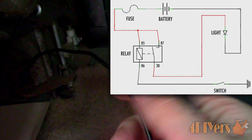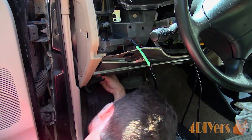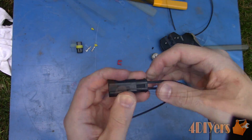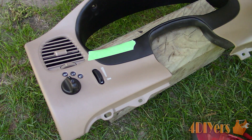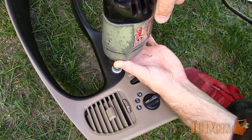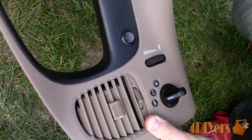I've already fed a rubber hose through where the wires will be running through the dash for the switch. Both wires will come through around the stock location where the existing headlight wires are run. Tape up the two wires then pull them through. These wires will also get a waterproof connector so the switch can easily be disconnected when the dashboard is disassembled. The switch will get a connector as well with a short pigtail, and the wire is soldered to the terminals, which is sealed using shrink tube afterwards. Drilling the hole in the dashboard can be a little challenging if you don't have a larger-size drill bit for the switch — I used a wood spur bit, covered the surface with tape as protection, and then cut the hole. The spur bit does a clean cut into plastic, but it needed to be slightly larger so I used an abrasive bit to open it up slightly. Reassemble the dashboard and install the switch, which just snaps into the hole — I purchased these switches off eBay, bought them in bulk.